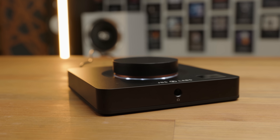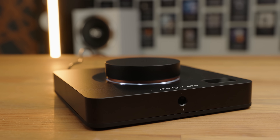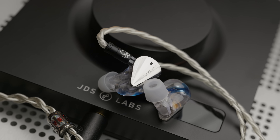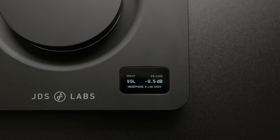So build and feature-wise, this is awesome. It'll run just about any headphones you need, looks and feels great to use, and has built-in EQ. It's also really good for IEMs — signal-to-noise ratio at 50 millivolts for very sensitive headphones like IEMs was really good, putting it close to the very best you can get, giving it a little bit more dynamic range than something like a Chord Mojo 2. The device also has a 0.2 ohm output impedance, so it's not going to affect the frequency response of your headphones or IEMs. And the digital volume control means you get absolutely perfect channel balance at all levels, so you won't get that imbalance that you get at low volume levels on many amps using potentiometer volume control, which can be quite frustrating for IEM users.